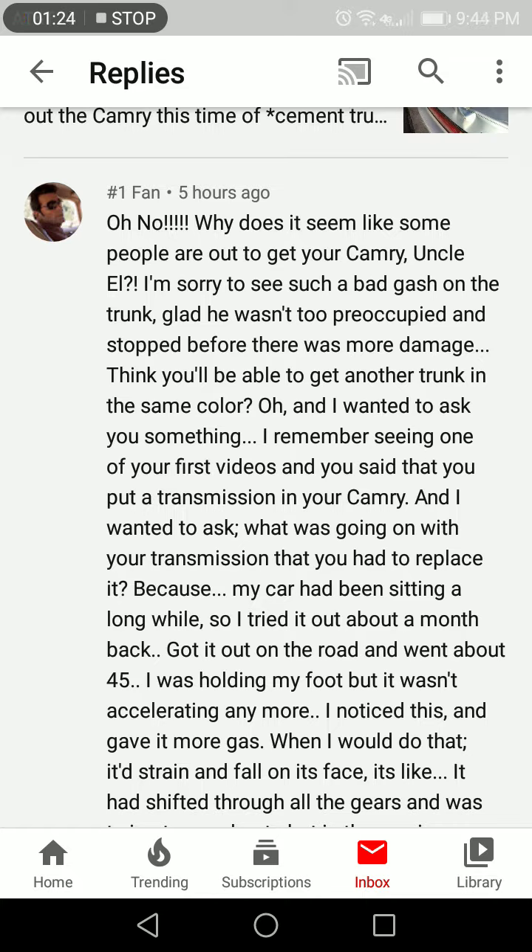I posted a link to a video that shows the solenoid. It's pretty rednecky but I think it's a solenoid issue. There's a way to test them with an ohm tester if you read through the description. You might drop the pan — I did a power flush on mine, which wasn't recommended. They were on it for about 20 minutes getting all the black oil out. My tip: I just went to the junkyard — transmissions go for about $150, and some of them last forever.